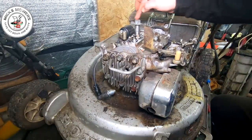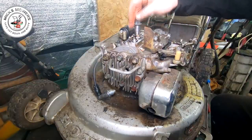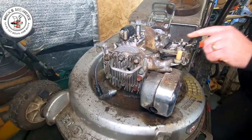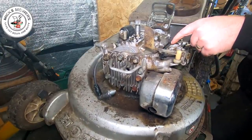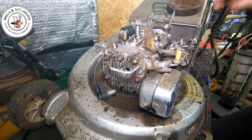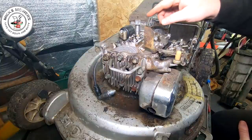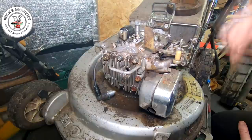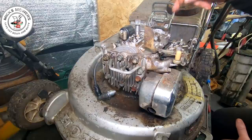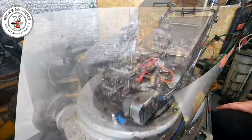Okay, the coil's now been cleaned — just undid it, lifted it off slightly, put some sandpaper in — that's all been cleaned up. All the posts have been cleaned up as well, points have been cleaned up. All these connections are good and this little switch here seems to be working too, making contact as it should. So I'm going to put it all back together, put the flywheel back on, put the cover back on and give it a test — try spinning it over to see if we get a spark. If not, I'll have to go down the road of testing the points, condenser, and switch. Hopefully a quick clean-up fix and away we go — we'll wait and see.